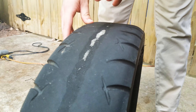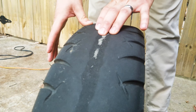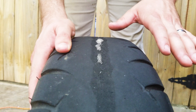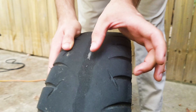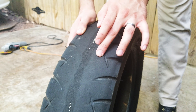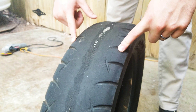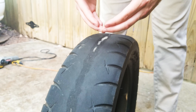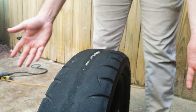This is a perfect example of what overinflation looks like. Motorcycle tires only ride on this portion of the tire anyway. If you imagine that it looked like a car tire before — if the center is worn out a lot more than the outside edges, this would indicate that the center of the tire is bowing out towards the road surface, meaning there's too much air in it.